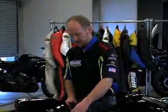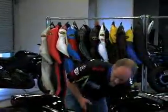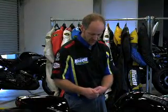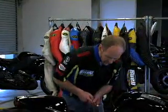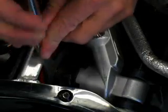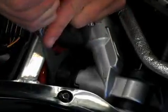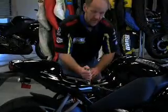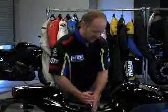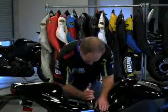It's real easy. You just take the seat off — two little bolts here, the seat comes right off. In the tool kit there's a handy little spanner wrench. To reduce the preload, just use the spanner wrench. There are nine clicks, and depending on the chart and how much rider weight and cargo weight you have, you can set it to however many clicks you want.